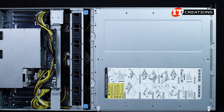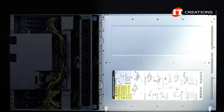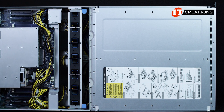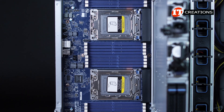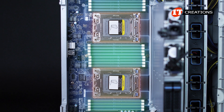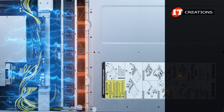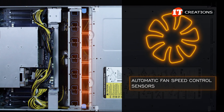Removing the middle cover and rear cover panel, you can see this platform does not have a standard server layout. All the storage is at the front of the chassis, and storage occupies more than half the chassis length, with CPUs, memory, and PCI slots all squeezed in at the back. The PSUs are in a tilt-up cage, and just beneath are two CPU sockets, four memory module slots to either side for 16 total, and a bank of three PCI 4.0 slots to either side. Just behind the storage cages, six fans pull fresh air in through the case with automatic fan speed control for optimal cooling and power efficiency.